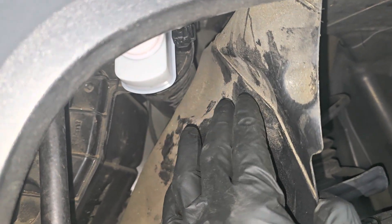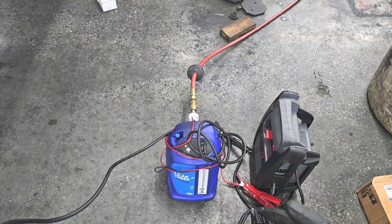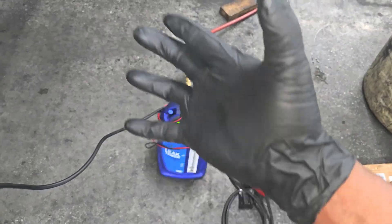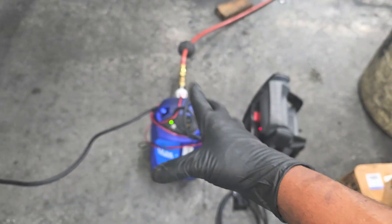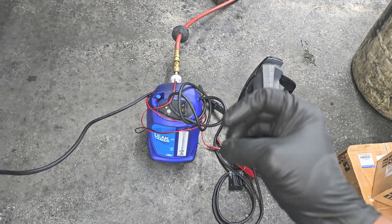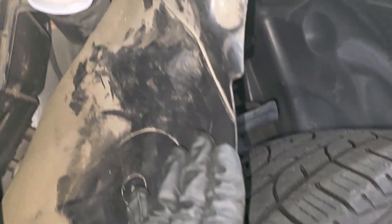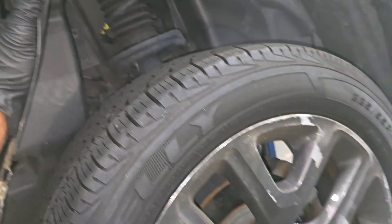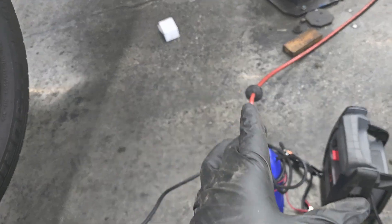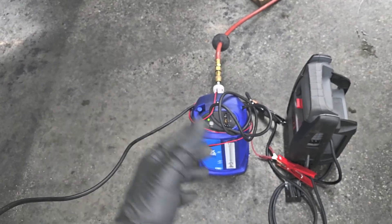The complete system is not expensive enough to warrant guessing. Remember, the average shop will charge you a couple hundred bucks to diagnose your car. That couple hundred bucks could probably cover all three of those parts. If you still have a leak after that, you've got a hose leaking that's not visible to the naked eye - you need a smoke machine to fill the system and look for the smoke to determine where the leak is. This is a Jeep Renegade, so does the EVAP system monitor and purge valve exceed $150? That's what the average shop charges to smoke test your car.